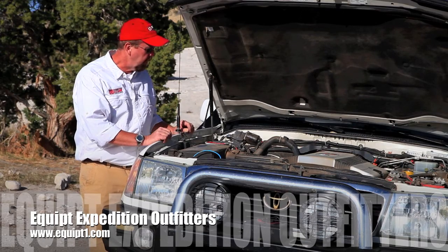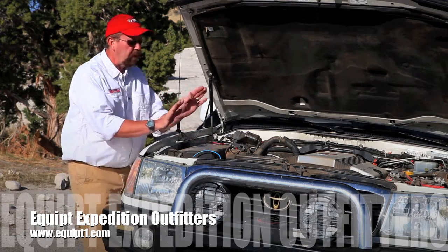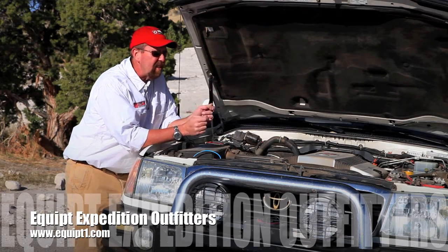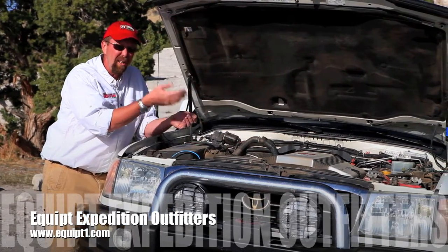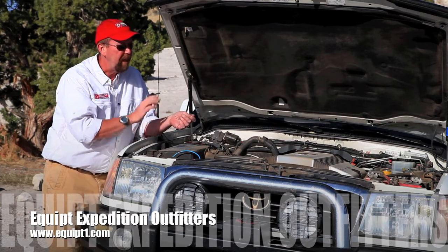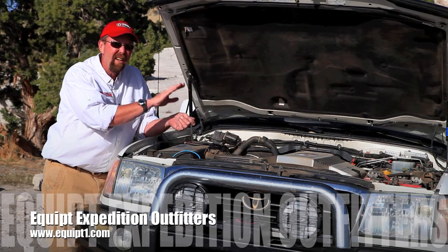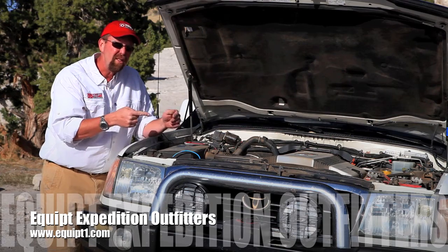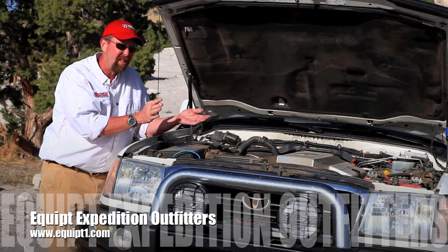As far as the operation of the Intelligent Solenoid, once you have it hooked up, it monitors the power to both of your batteries. When it senses more than 13.1 volts coming to the main battery, it realizes that the vehicle is on and ready to charge the batteries. It has a timer that holds the charge to the main battery for five minutes to recoup for the discharge of starting your vehicle. After that five minutes, it closes the contact and puts the batteries in parallel, charging both simultaneously.